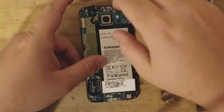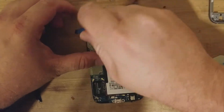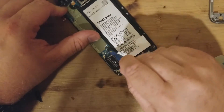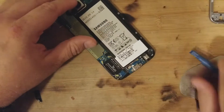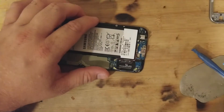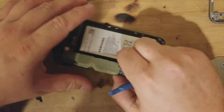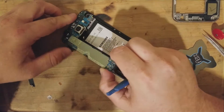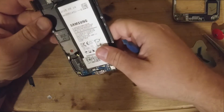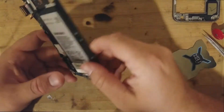We're going to pop out the battery with our finger now, or actually use a plastic tool and pop this out. We're going to pop out the LCD cable, ear speaker cable, and button. Then let's get my tweezers out for these ones — they're antennas, my favorite. Just go right behind and pop up. And then get underneath the motherboard and just twist away from the charge port, and that should pop right up. Then we can lift up the board, move away the cables, and the board's out. Now we can warm up the unit for about 30 seconds and we can pop out the battery. Just be careful not to bend it out too much, as you can potentially break your LCD, and you don't want to do that.